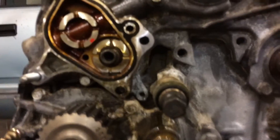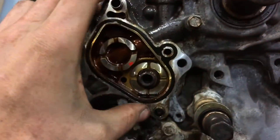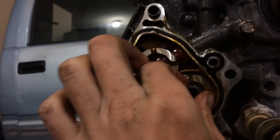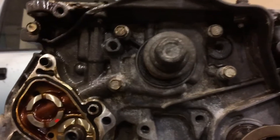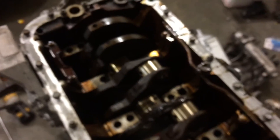Which will be fun. But I've taken the cover for one of the balance shafts off — this one is the one that's a gear reduction, and you have to make sure it's all in line. But I have everything marked, as you can see. So right now I'm taking off the oil pump to be able to get the crank out. I think that's probably the best way to go about it. I could go from this side also, but either way it's going to be a pain.